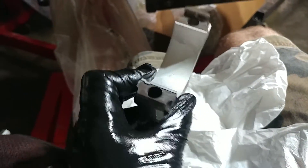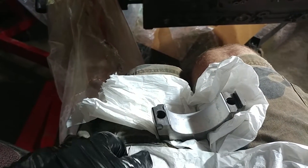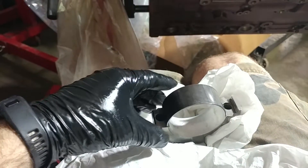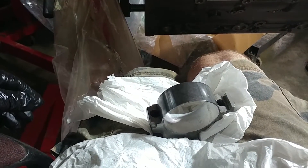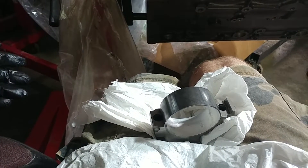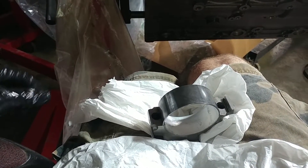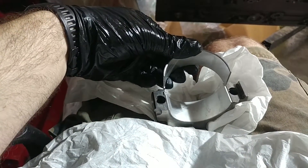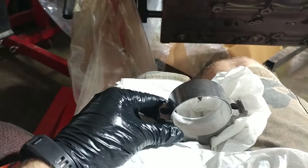The tang is on the right here, but the tang is on the left on the rod — wait a second. These are common rail connecting rod bearings, which you order by year, which is exactly what our machinist did. He hooked us up, said he could get us a kit. He even had the rods, but there's no way he'd know — he doesn't do enough of these — and I didn't spell it out for him, so my bad. On common rails, the tangs go right over the top of each other, as we see here.